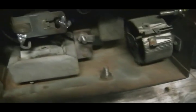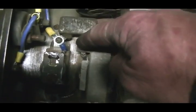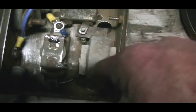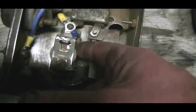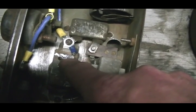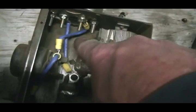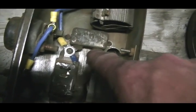Maybe someone can give me some hints on why it's set up like that. I'll just run through it again. It comes from the generator onto this pin, through this big single wire inductor, then through this other bobbin inductor, which I believe is an electromagnet to pull the contacts down. The current continues on through here, through the amp gauge, back out to the battery positive. But there's also a bridge by this box here, and I can't read the writing on it — it's too far gone.